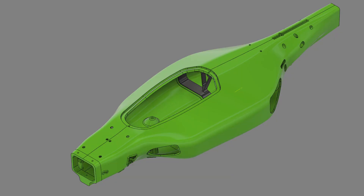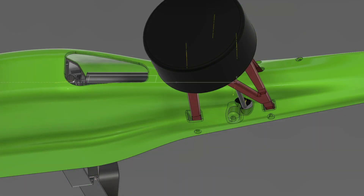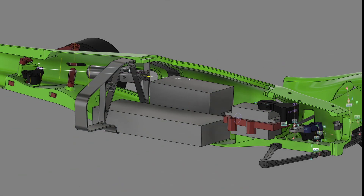The overall shape of the hypercar's monocoque is driven almost exclusively by packaging and aerodynamics. The monocoque at the front is as narrow as possible to allow the most airflow extraction from the front wing while still having enough room to mount the front suspension components. The rear is as narrow as possible to allow as large a diffuser outlet as possible. The middle of the monocoque houses the actual guts of the car. Initially I made this as tight as possible and it was a real nightmare to fit all the components and assemble it. I've since learned from CFD tests that a wider monocoque in the middle actually helps manage the airflow.